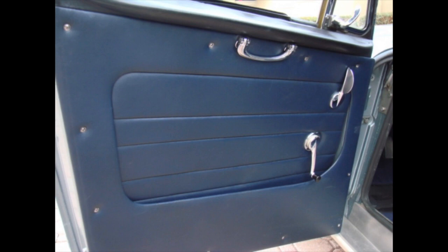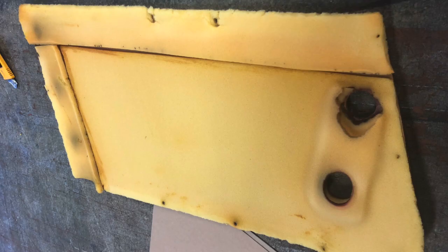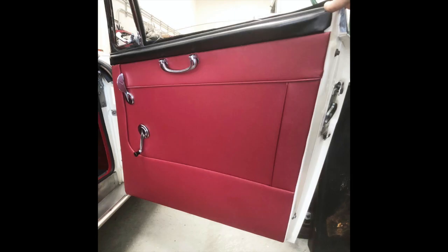With the introduction of wind-up windows in the BJ-7, they trimmed a pressed aluminum panel with a thin pleated cover and then covered over that with a familiar-looking outer trim panel. With the BJ-8, they came up with entirely redesigned Masonite panels trimmed with thicker 1/8 and 1/4 inch foams, riveted together as a complete panel, and used a stretch type of vinyl instead of the old Vynide.